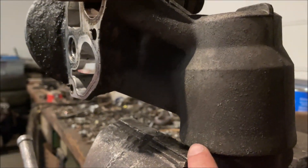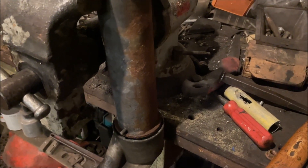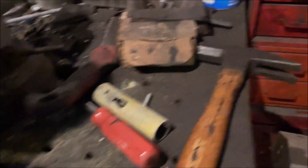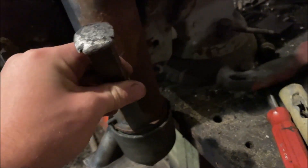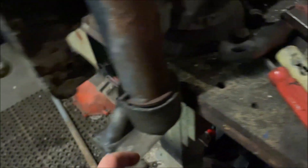You're not going to be working against the rubber mallet — it just takes way too much to take these ends off doing it that way. Use a dull chisel, not a sharp chisel, so that you don't crack the aluminum. When you have it set up like this, it's not going to be that hard to take off — it literally pops right off. Stick your chisel right in there, get your hammer, and tap it away. Use mechanical common sense and don't wham the thing — all it should take is taps, work it around the outside.